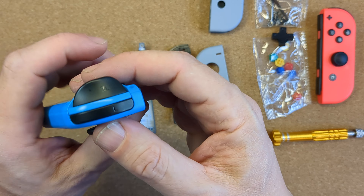Undo the three screws at the top for the shoulder button ribbon and remove that part. Then take out the silicone membrane and the minus button, drop it in the new shell, add the silicone membrane over the top and then put the ribbon back in place with the three screws. These are screws going into new holes so go slowly, make sure they're aligned properly and don't over-tighten them. Next there's the dust shield for the joystick, held in place with a couple of sticky pads. It's worth removing any dust while it's out of the shell. Look for the two little cross-shaped bumps that the holes locate around and then push the sticky pads back down in place.